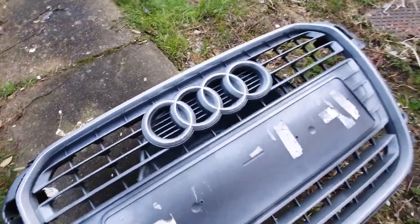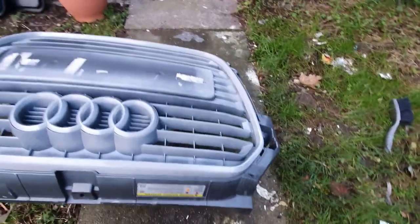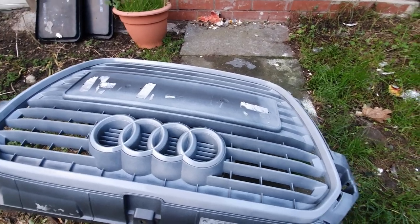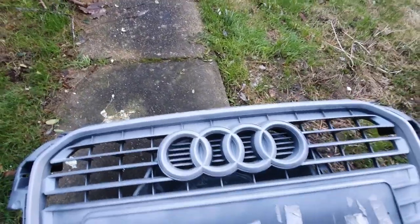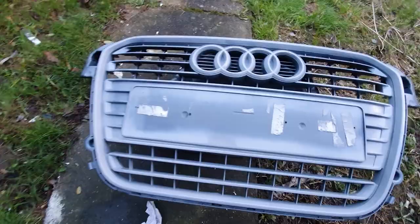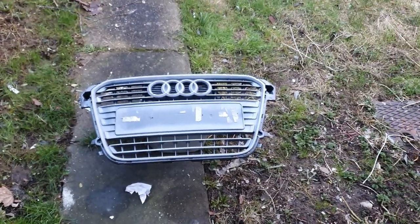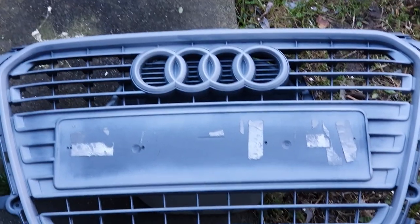As you can see it's starting to look grey now. Just try and make sure you get a light coating over as much surface as possible, so when you second coat it there's no black remaining. Happy with that — first coat on. When you finish spraying, just tip the can upside down and spray it until it sprays clear, just to free your nozzle of any spray paint. As you can see, coming along nicely.